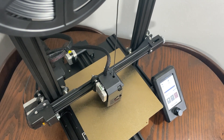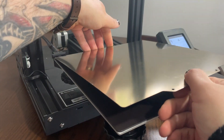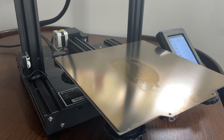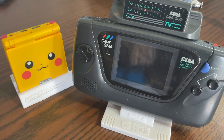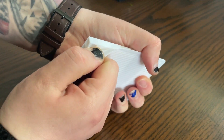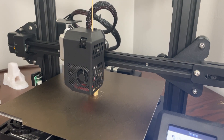Moving on to the actual printing: outside of the first few test prints, the textured bed has been really helpful when dealing with basic PLA, and it also comes in handy when using things like silk PLA, which can struggle to adhere properly. If you have a preference for using an adhesive, you can swap to the smooth side of the bed and use hairspray or glue to keep your prints attached, but for the most part the textured bed alone does a decent job. We've printed several different figures, models, and especially a fair amount of usable prints. For example, we managed to produce several stands for some relatively chunky gaming systems, and these have mostly worked quite well. The only issue we encountered was with rafts that would sometimes be hard to remove completely, but that's potentially fixable by changing some settings. Rafts really aren't that necessary with this machine anyway — the bed is heated and textured, so brims work just as well and don't get badly stuck to your prints.